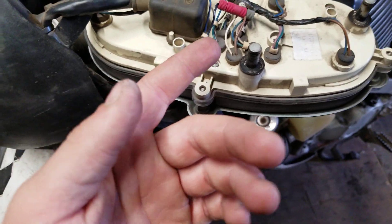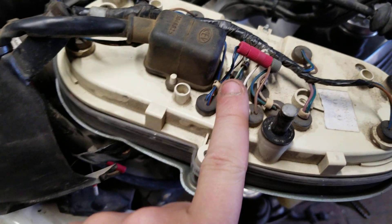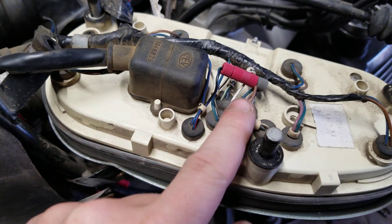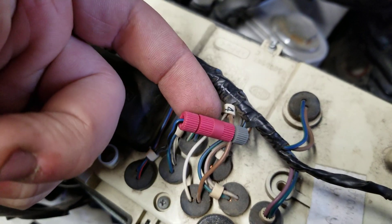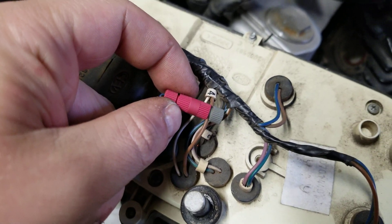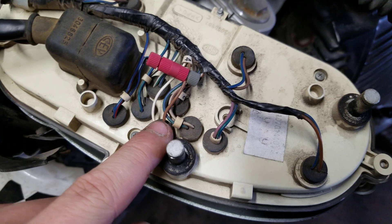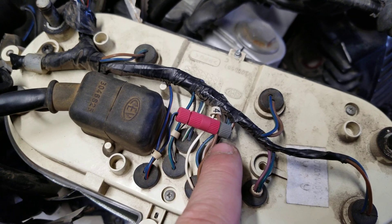So here's what you do. On the F650 GS specifically, you take one side — so we're going to start here at the bulb. You take one side of the bulb and you ground it. I've got a Posi-tap connector here. Brown is ground — you can see you've got a brown here, a brown there, a brown there, a brown there. So that's ground. You take one side of the bulb and you ground it.